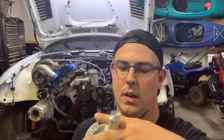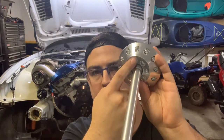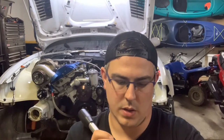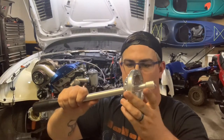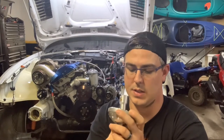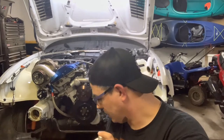I'll need to make something to protect the bottom and keep water out. The nice thing is there's a second ring of bolts here, so it looks like it is serviceable — if you need to oil it, grease it, or clean up any corrosion in that joint. Otherwise it feels really good; it feels tight, there's no side-to-side play when you hold it, which tells me that ball is nice and tight in there. I think this should be a good budget shifter.